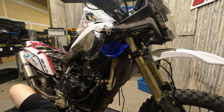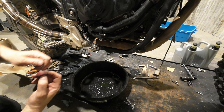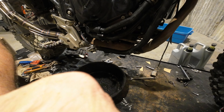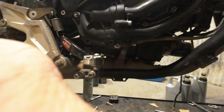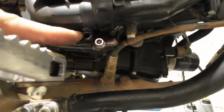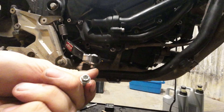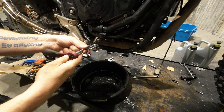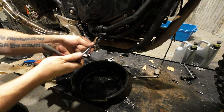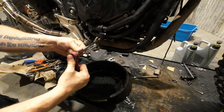Why am I leaking there? Very strange — leaks with a bolt in but doesn't leak with one out. So although the bolt length was right, it's a large flange that started to hit the casing on the water pump. I'm going to put some smaller flange stuff in there — the right length and right thread, just not the right head. It's weird that it stopped leaking as soon as I took the bolt out.